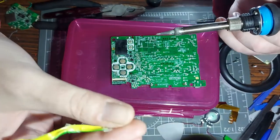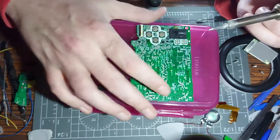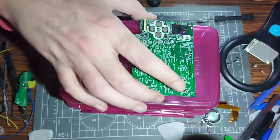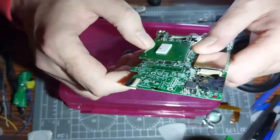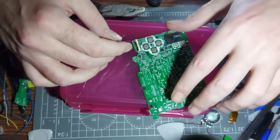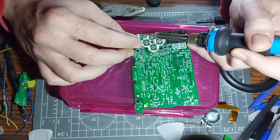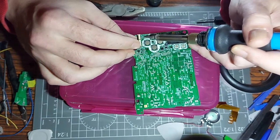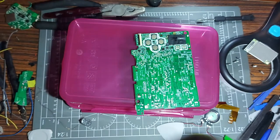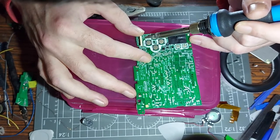I popped one side so I'm redoing it - I'll do it more tidily. These are twisted together to make one connection to simulate a stereo speaker. What's ironic is I think both speakers actually have a connection through the pin-out on the actual connector, so I don't understand why only one speaker - doesn't make much sense. Anyway, I'm just going to get a little bit of solder off by dabbing my tip and just touching, so I don't lose the pads as they are.